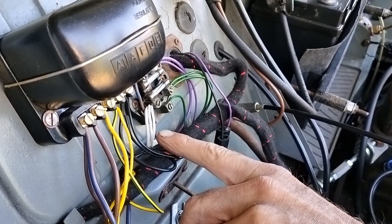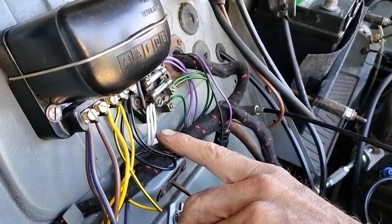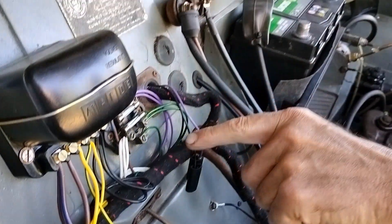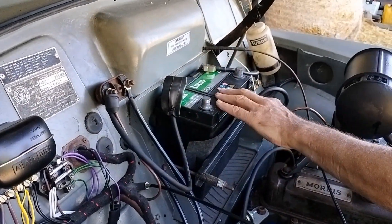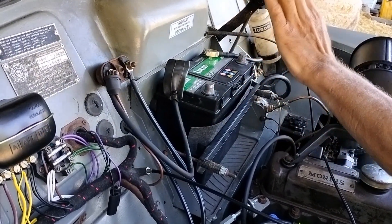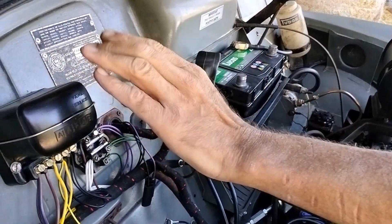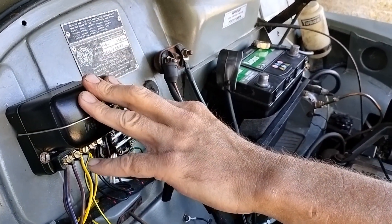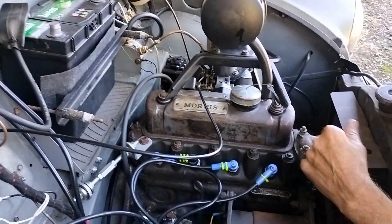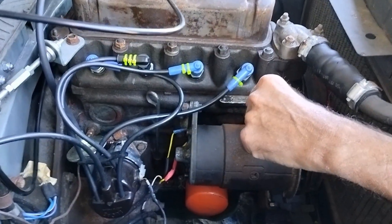If your battery has just been used to start your engine, it's going to want charging, so the control box allows current through from your dynamo through the wiring to your battery. Once your battery is fully charged, the switch in here will switch off and stop the battery from overcharging, until the battery is required to draw more current again and the dynamo feeds back through.